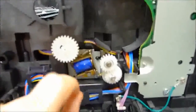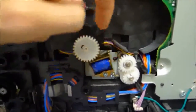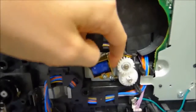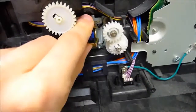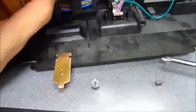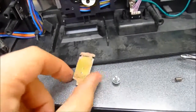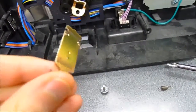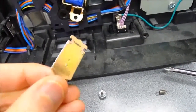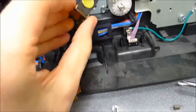The one that causes the duplex problems in particular, I think, is this one, which has the exact same problem as the other ones. So, we have to remove those solenoids. Once you have the solenoid removed, just one screw down there should do it. What you can do is remove the spring from the solenoid that holds the armature in place. You can already see that there's all kinds of black gunk caked on the top and bottom there. That's the remainder of the bumper.